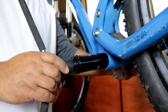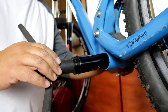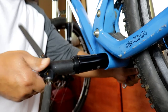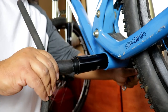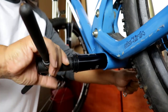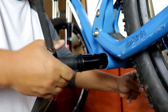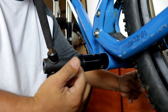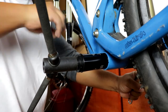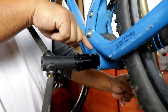With this in place, all I need to do is start turning clockwise — righty-tighty — to get this to compress. The tool is set up so I can attach a crescent wrench or some kind of wrench to stop it from moving. I can see I'm just starting to get some resistance, which is good, and I can slowly see the bottom bracket starting to go in. It's going in very smooth. At some point I'll get to the end of my threads and it won't let me push in anymore — at that point I'll adjust the tool and move my locking nut closer so I can continue threading.